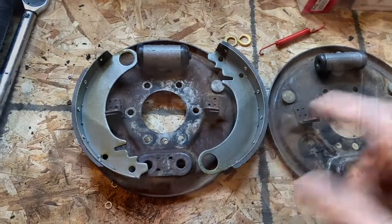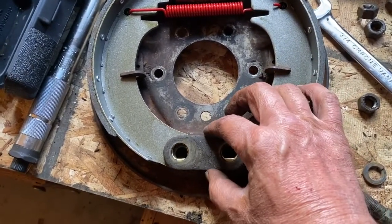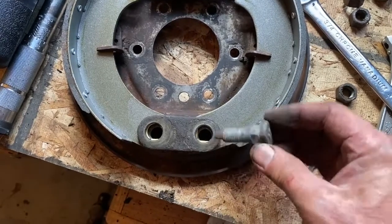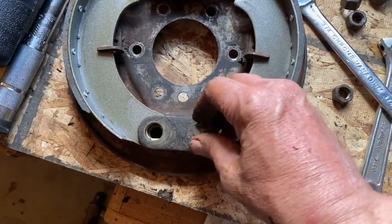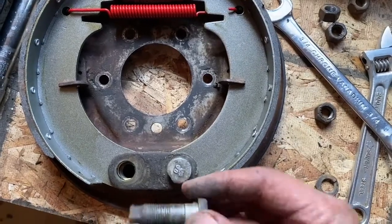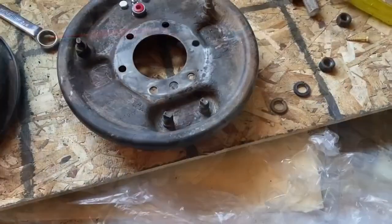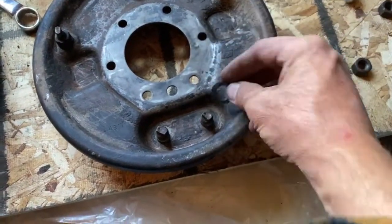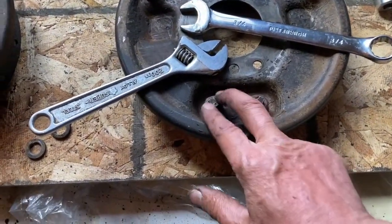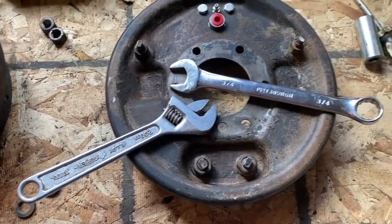I put the cam washers in place. Now put the plate in next and position the cam bolt — there's an obvious way with a curved area and a 90-degree notch; it only goes one way. You may need to tap it down slightly with a hammer. When putting the cam bolts through, don't forget to put the lock washers in place before you put the nuts on. Use a crescent wrench holding the cam side and a three-quarter inch wrench to tighten. They're pigeon-toed in — pretty sure that's the right starting position when setting the brakes.